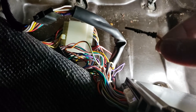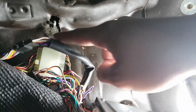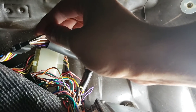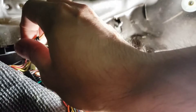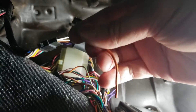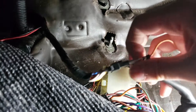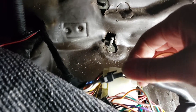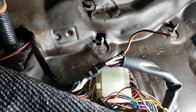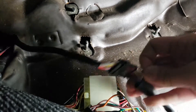What I've done is taken a pin from my distributor and poked it into this wire here — this is the ECU wire that goes out to the engine bay to the O2 sensor. By pinning it here and taping it with electrical tape, it holds in place and I can detach it whenever I want. I'm wrapping it with electrical tape to prevent any shorting, then wiring this to the purple signal wire on the gauge. This makes it fully detachable — if I ever want to remove the gauge, I just yank the pin out and it's done.